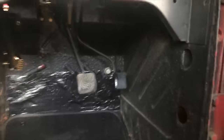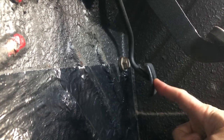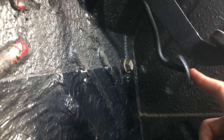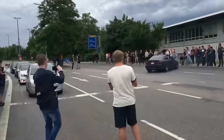For driver controls, the throttle attachment is straightforward because it's a push-pull cable on both the motorcycle and the car. I replaced the cable with a new one using parts from a bicycle shop. I have an adjustable hard stop — just a big bolt bolted to the firewall — and it's important to do this. If you mash the throttle all the way down you want a positive stop rather than just stretching the cable, because a broken cable could prevent you from stopping safely.